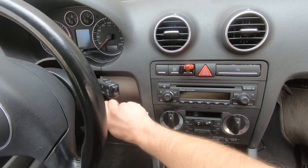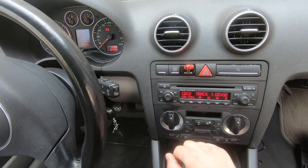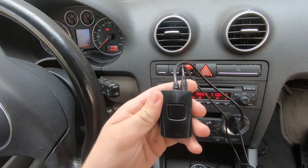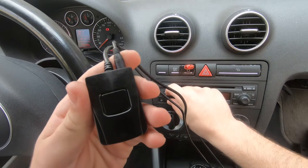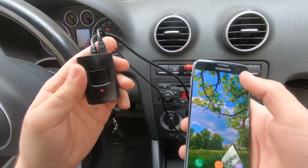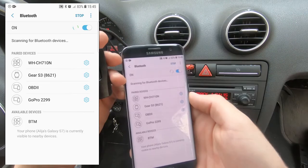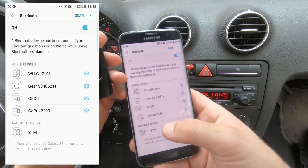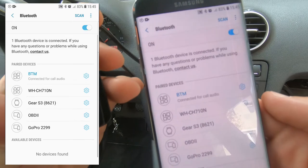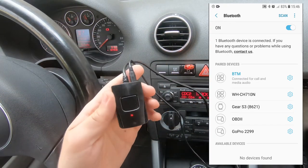Turn the key to accessory mode and turn on the radio. The music you hear right now is coming from the USB stick above the radio. If you look at the Bluetooth module, you can see the light blinks every 2 or 3 seconds, which means the module is in pairing mode and is not connected to any device. I will now take my phone and try to connect it to the module. I will go to Bluetooth settings by holding the Bluetooth icon, then turn on my phone's Bluetooth. After some time, a new device with the name BTM appears in the list of available devices. That is our module — click on it to connect. Immediately after the successful connection, the light on the module stops blinking and there is now a solid red light, which means the module is connected to the phone.